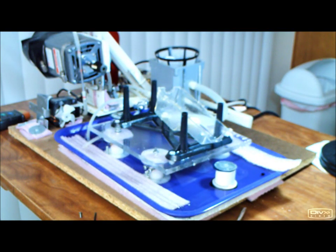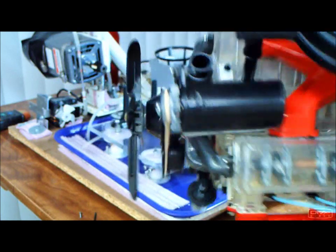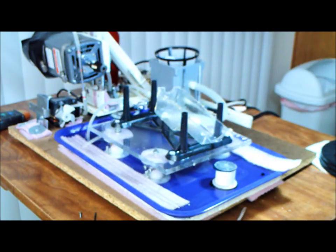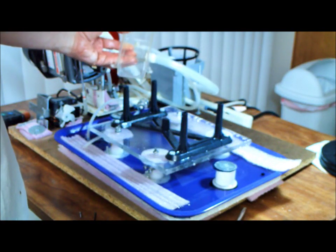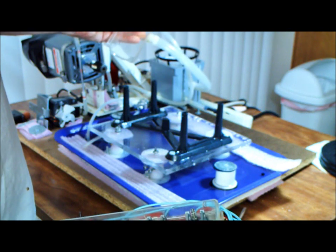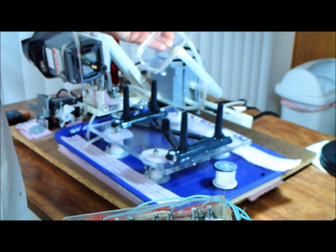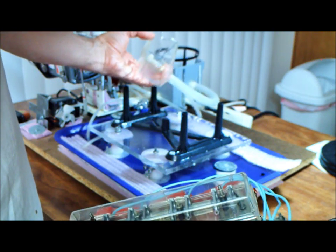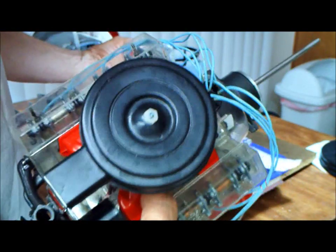We're over here at the visible V8 testing facility, and here is the visible V8 that we've been working on at the shop. We're going to go ahead and mount that on the test stand. There's a pan here, and the pan is connected to the sump over here with silicon tubing. This is a dry sump system, so the pan just acts as a collector — there's really no storage in the pan; it's all done over here.